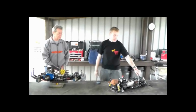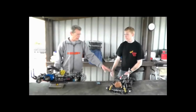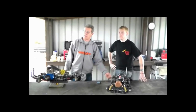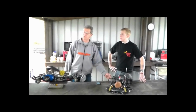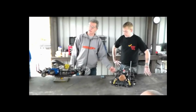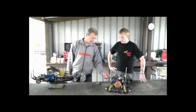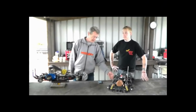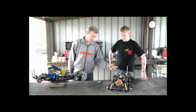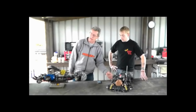You can change it by the feeler gauges. You want the fronts to brake before the rears, always. But the problem is, if you brake the front, you've got the belt that joins the back wheel. It's only a two-channel, so it automatically brakes the back as well. But you can adjust the thickness of the disc, so that when you put the brake on, you can make that one a little bit wider, that one a bit smaller, so the fronts just start braking before it brakes all.